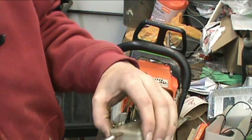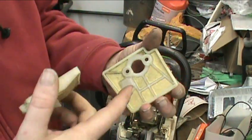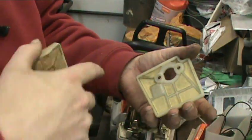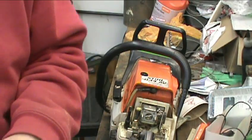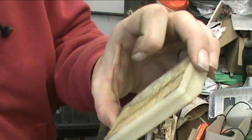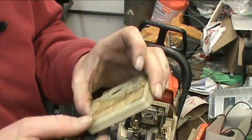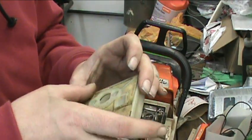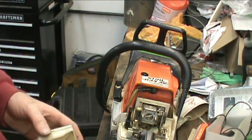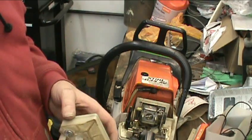See there's a little notch right there — you can split it in two and take an air compressor and blow it from the other side, blow it from inside out. Don't use a lot of air pressure, do it gently. Took the air compressor to it, blew all the dirt off of it. Next time it's just gonna be replaced, but for the time being it'll serve its purpose. Alright, I'm gonna install this and then I guess it's time to gas it up and oil it up — the fun begins!